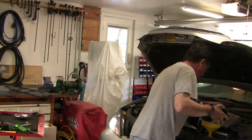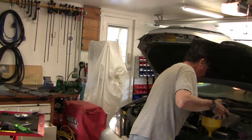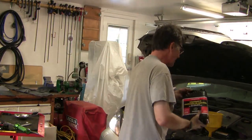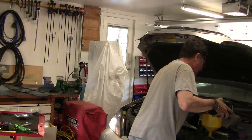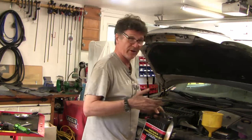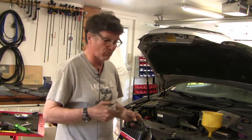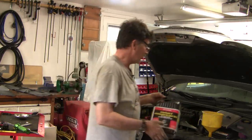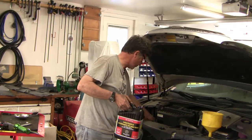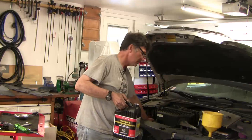Right now I'm adding coolant. I've put in about five or six liters so far, and with the engine running we just keep adding coolant. The tricky thing with the hybrid is it turns itself off intermittently. To try and keep the engine running, I've got the AC going and the seat heaters going as well, which provides some electrical drain and tells the hybrid motor it's got to keep running — otherwise it shuts off, because it knows the car is stationary and doesn't see a reason to run the motor. You've got to run the engine until the thermostat is warm. I can feel air in this hose, so you still have to wait a little while until that warms up and you get that air bubble out of the system.